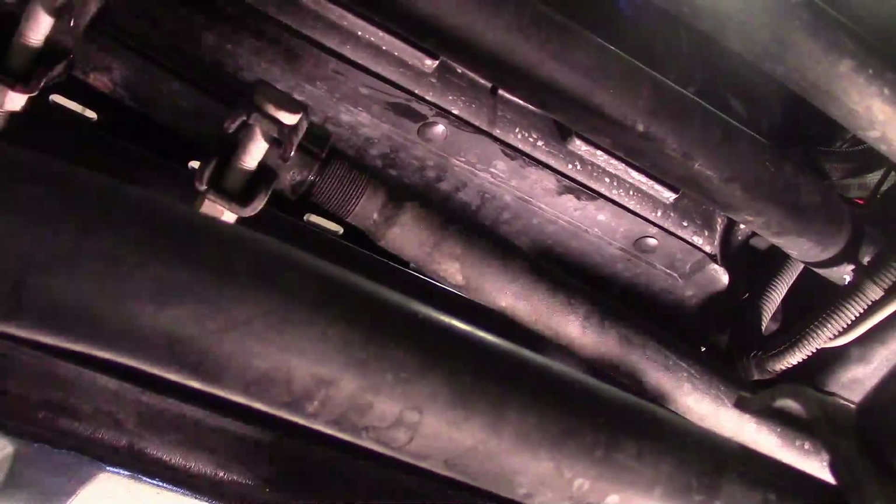So before we can get that radiator shroud out with the electric fan, what we're going to have to do is we've got a total of 3 plastic Christmas tree fasteners holding a plastic air dam up under that we've got to pop loose. So we get up in there with our little tools that we've been using already to try to get the front off. We'll try to get down in there the best we can with the camera rolling. A little tight squeeze.